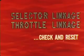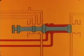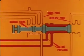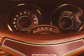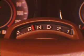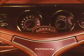Assuming the fluid is okay, the selector linkage and throttle linkage adjustments should be checked and reset if necessary, so you won't have to consider them as possible trouble spots when you road test the transmission. In neutral, the selector lever detent should position the manual valve so that both the drive and reverse ports in the valve body are cut off from line pressure. If the linkage is not properly adjusted, it positions the valve off-center, opening one of the ports to line pressure, which can cause creeping or clutch slipping depending on how far the valve moves. Checking the selector linkage adjustment is easy: with the engine stopped, move the selector lever slowly until it drops into the park notch of the shift gate. If the starter operates at this point, park position is okay. Then move the selector lever slowly toward neutral and stop when the neutral detent bottoms. If the starter also operates at this point, the selector linkage is properly adjusted.